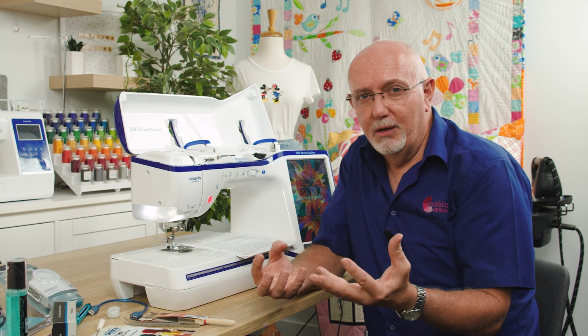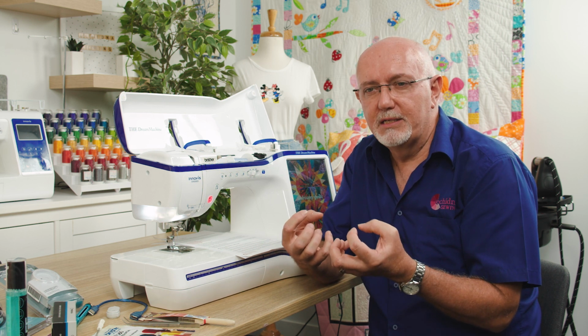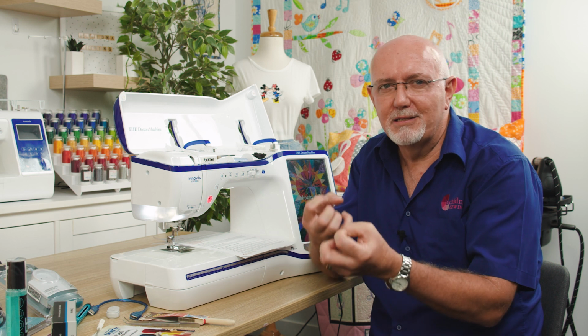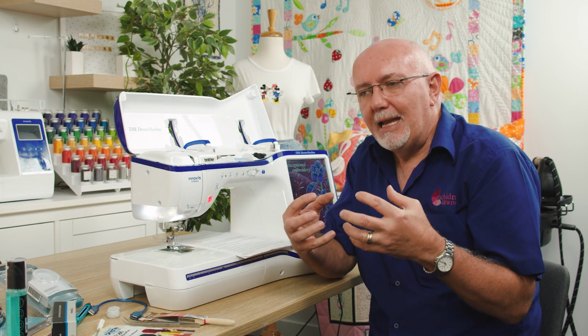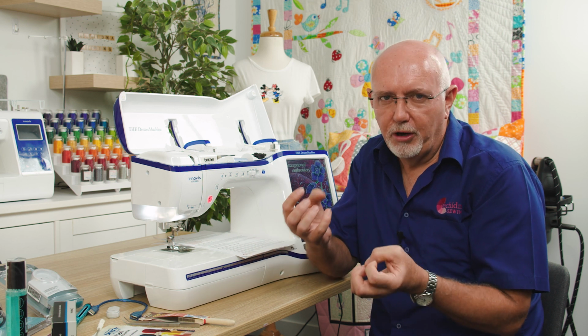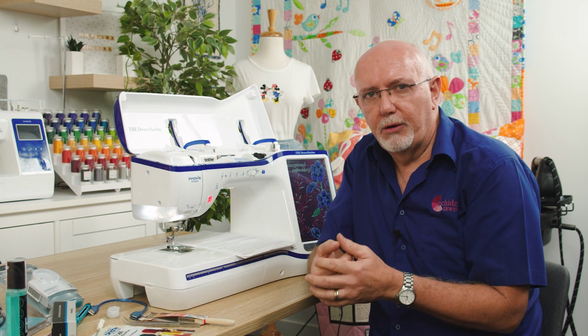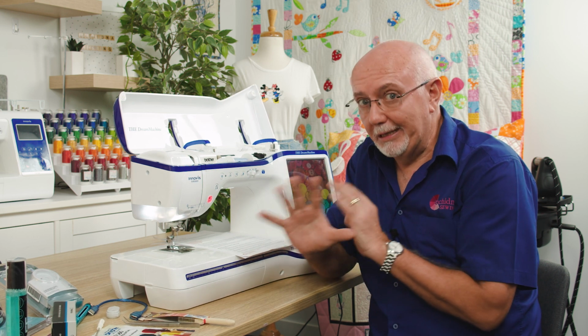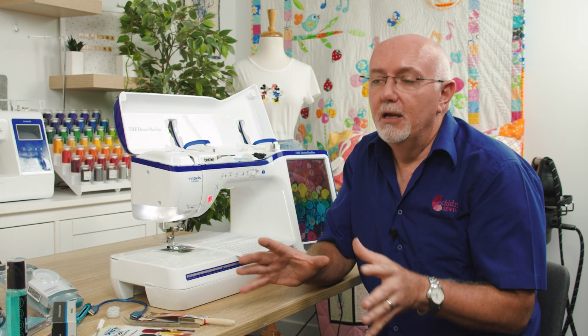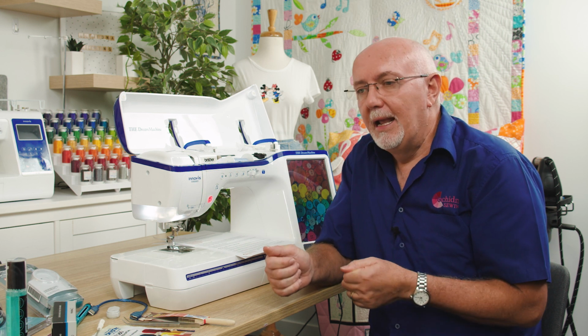If you're in a humid environment, it kind of goes the other way. You do get a lot of humidity build up on machines, and that promotes a bit of surface rust on parts, etc. So again, routine servicing is what helps prevent that climate controlled evaporation or clogging of lubricants and so on that are in the machine. So, I can't stress that enough, routine servicing. Most machine manufacturers will recommend a yearly service interval.